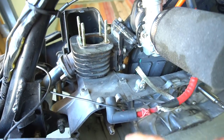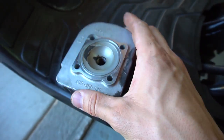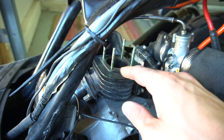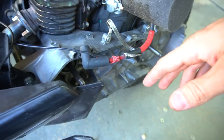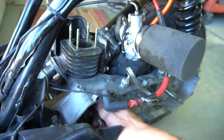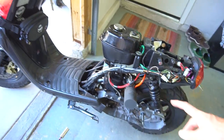There's a little noise in there — I feel like that's what I hear when it's revving really loud, the clacking. Might be the crank, might be the bearing. After checking everything and going through with a light, there's no scoring in the cylinder at all. The head looks way better; cleaned it up to get most of the residue off. Put a little bit of Honda Bond on the head since this is a used O-ring and I don't have another one to throw in here. Overall the cylinder looks good — there's a little play in the bottom end that I'm worried about, but I think this motor is going to hold.